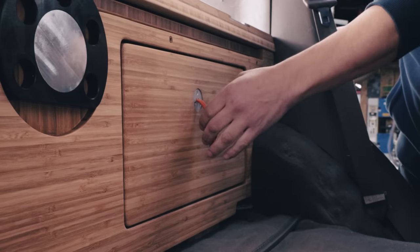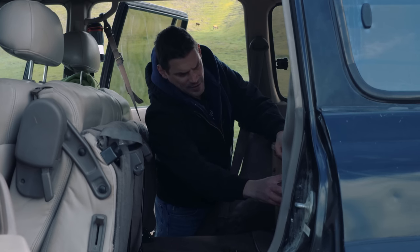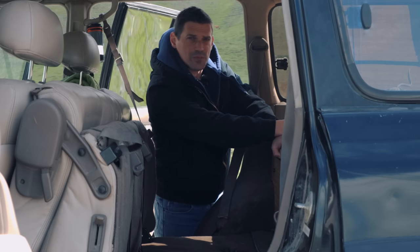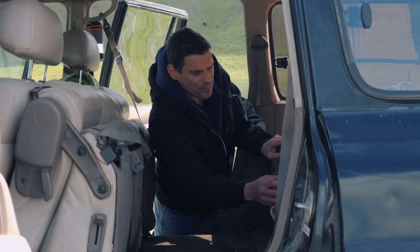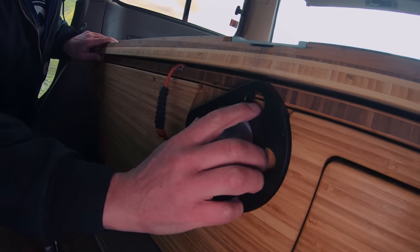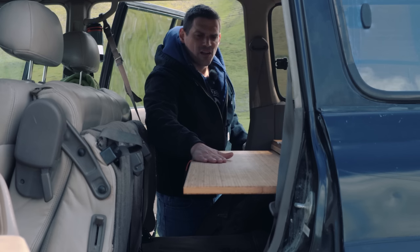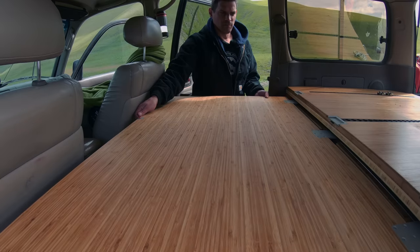The way this setup works: there's a hidden drawer right here behind the seat. These components — again, Parnell made them — hold the sleeping platform in the slot. We've got springs at the back of the slot on the frame that hold the platform under tension, so when you're going down the road it's not going to rattle. A cam holds it back against those springs.